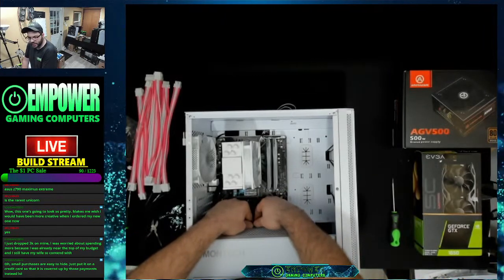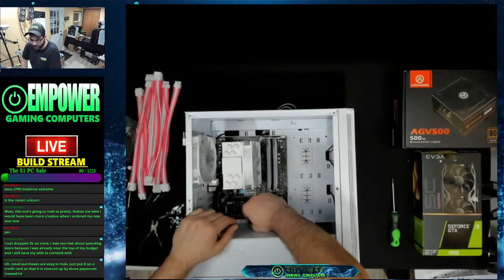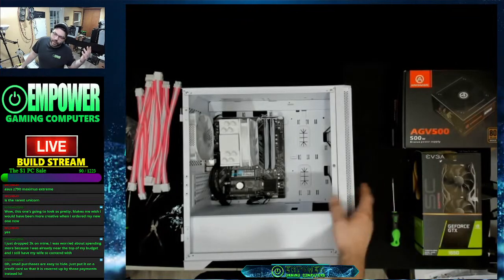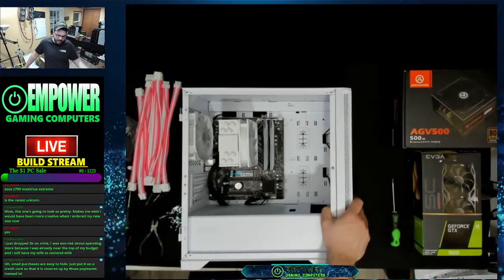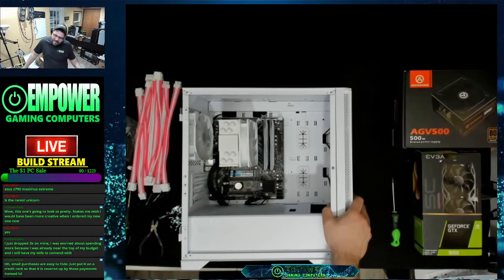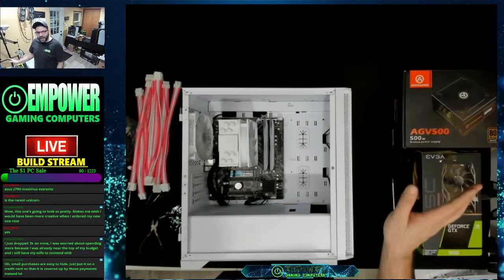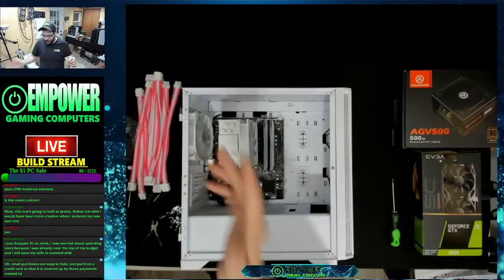I'm on a budget, and I was thinking should I build a PC or get one from you for a budget of 630, to be honest. Well, I think this one was 600, but they really leaned on the aesthetics. And honestly, this was only going to be playing like Sims 4, so I was a little bit lenient. I went with aesthetics more so than performance. But a $630 build, you could do like a 1660, Ryzen 5, 16 gigs of RAM, maybe squeeze in a terabyte SSD, depending on if we could get a good deal on a sale or not. But overall, it's gonna play pretty much any game at 1080p. Gonna look nice, and my cable management is top notch, and it'll be just like you built it, because you'll have all the parts and stuff.